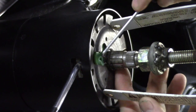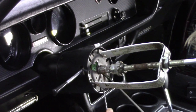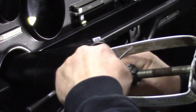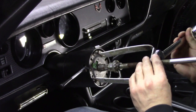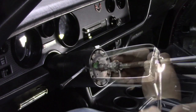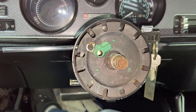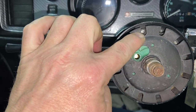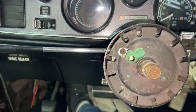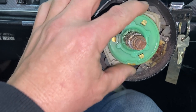Everything is now exposed and I can work with this pin until I get it out. The pin is rolled up and I can loosen this and everything slides right off the top of the shaft. There's our pin, and here comes our locking plate — I just had to keep wiggling it until it came off without prying and ruining the column. I'm noting the pin for the steering lock and the groove I'll line it back up with when reassembling. And there is our cancel cam.